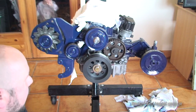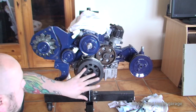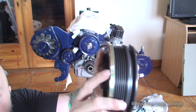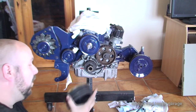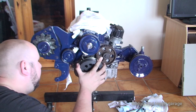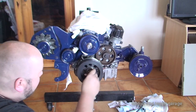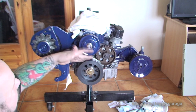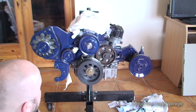I've also got a surprise which I put on Facebook — that's going to be when the engine's actually installed. I can't put this on properly yet because I still need to put the timing belt on first. I also cut a little notch out of there for the timing, which was in the other one too. So I'm just going to line that up, not put it all the way in yet, get the new bolt and just hold it in place. I have new fan belts as well, but again I can't put them on properly until I get the head on and the timing belt on.